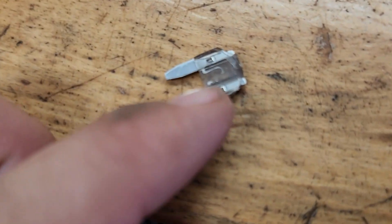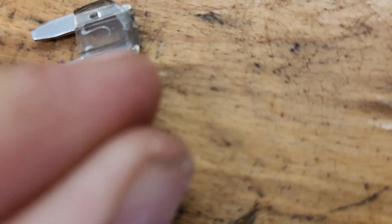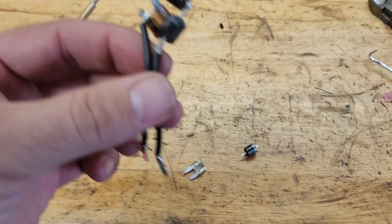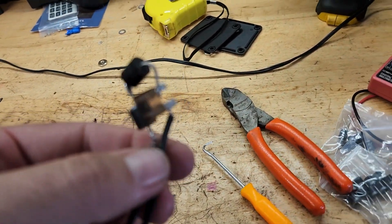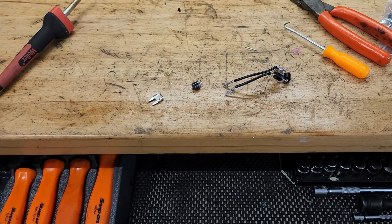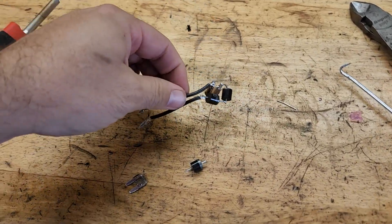It's pretty simple. Just take any old fuse, go in and break the contact — the fuse part — with a pick, or just blow the fuse with some current. Then take a razor blade and scrape off some plastic so you can get to the top of the contacts. Then take two wires, solder them on to each of those legs like that. Take however many diodes you want to put — I'm going to use one diode that does 0.2 volt and one that does 0.7 for a 0.9 volt increase. Solder them in series with another fuse so you still have your fuse, then plug that into your fuse box and you're done.